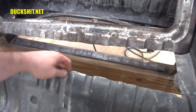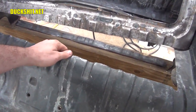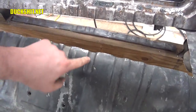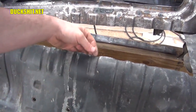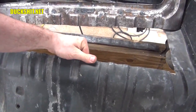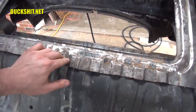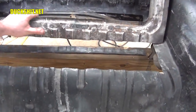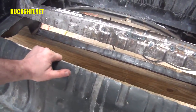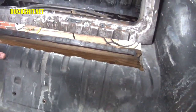And in here, in order to make this straight-edged, because of course it's wavy from all of these, what do they call this? It's a stamping, swedging. The swedging here, what I'll do is I'll cut a little slice into here, a little slice in here, about half an inch, removing these little pieces, and then using my flat pair of vise grips, clamp them like this, and then gently weld it through. A nice flat surface to work with, to join the areas together. That way the transition from the flat goes directly into the swedge here and gives us a nice transition. I think it'll look really good.